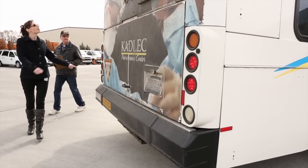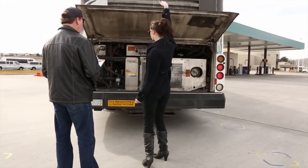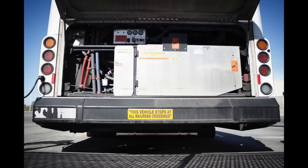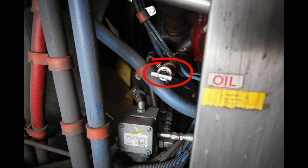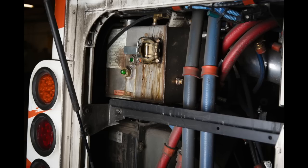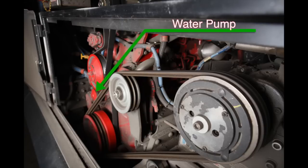As you come around the back side of the bus, check all the lights, then open the engine compartment. Check under the bus for fresh fluid leaks — be able to identify fuel, oil, or coolant leaks. Check the oil level; identify where the dipstick is and check that the oil level is within a safe operating range. Check the coolant level and inspect the reservoir sight glass. Identify the location of the water pump, check that it is securely mounted, and check for any fluid leaks from the water pump.